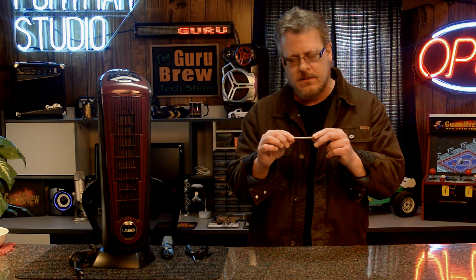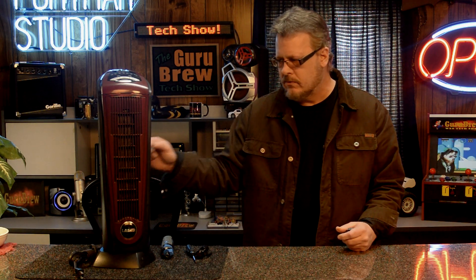As far as how to crack it open, just some basic tools: screwdriver, flashlight, and a screwdriver bit set. Now, the one thing you might not have that is needed for a lot of these type of space heaters is a really long bit. See how long that is — this is just a Phillips bit, but it fits inside the long screw cavities inside these.